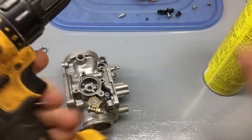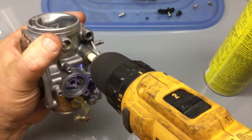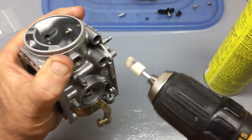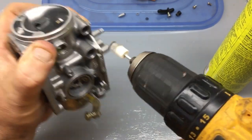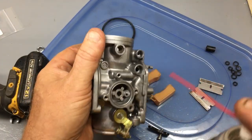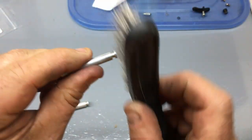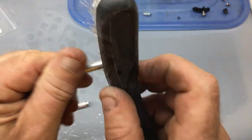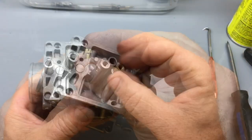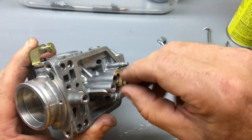These small felt buffing wheels come in really handy for cleaning and polishing the mating surfaces where the O-rings on the fuel and air tubes seat. One little bit of debris can mean a leak, so it's pretty important that we get these spotless. Now that I'm convinced that things are meticulously clean, it's really just a matter of putting everything back the way I found it.